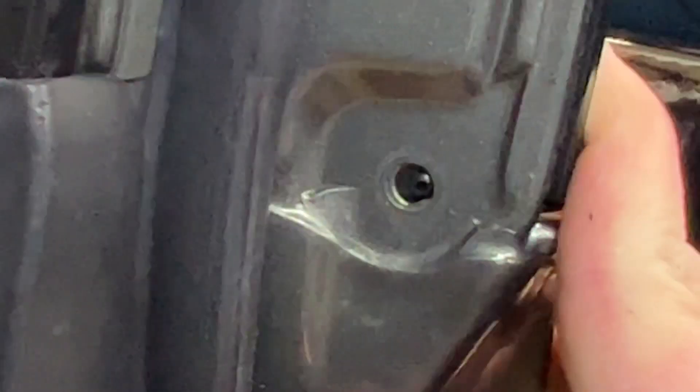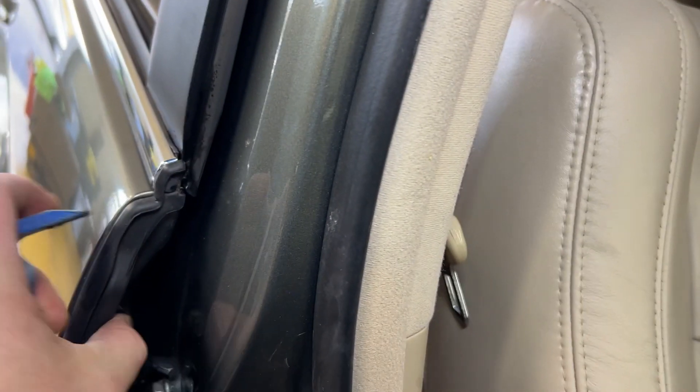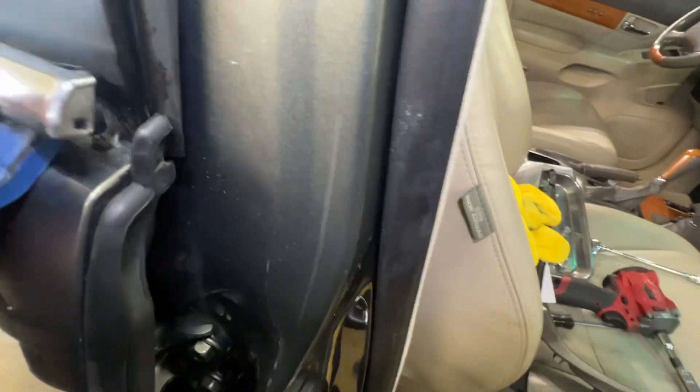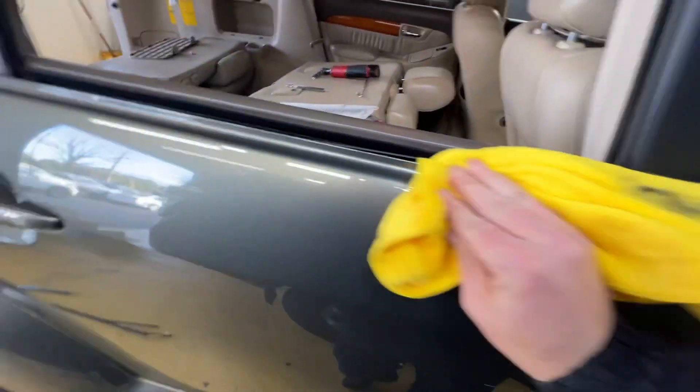Line up with your screw tip. Some of these have a little clip right there — take a trim tool and pop that out, because none of the replacements, OEM or not, that I've gotten have that same clip hole. Just get a trim tool in there and pop that clip off. Sorry about the video quality — one-handed without my gimbal. Once the set screw's out, bend these up and they'll pop right off. Take the time to wipe out that area.